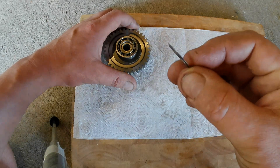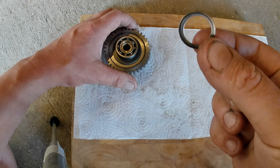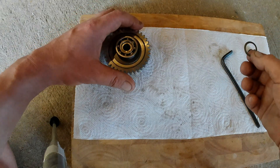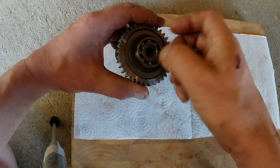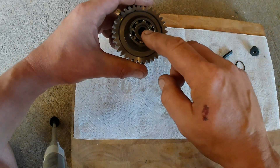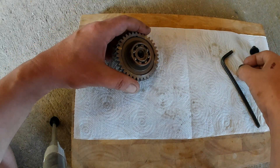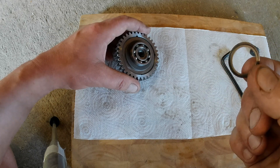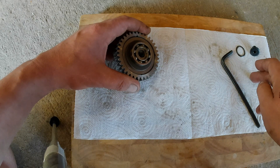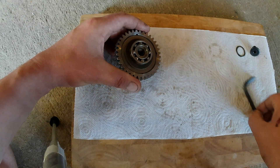I've measured this shim — hopefully you can see it's extremely deformed. I managed to measure the bit in the middle that was between the screw and the bearing. When you get a new one, the bearing comes with it, because this screw holds the bearing into place using the inner race to press on what I believe is called a Belleville spring. This deformed one measures 0.5mm. The shim set includes 0.6, 0.5, 0.4, and 0.3mm thickness options.